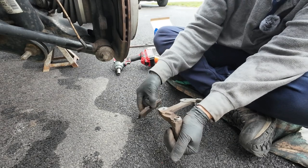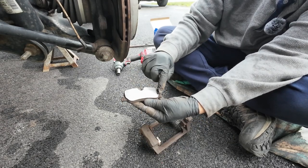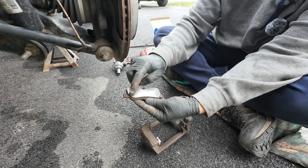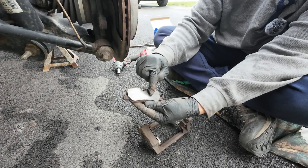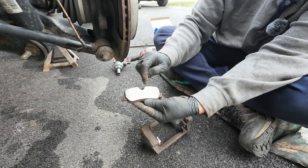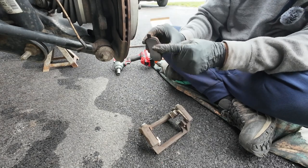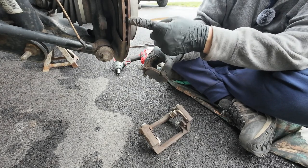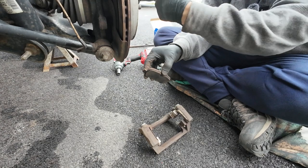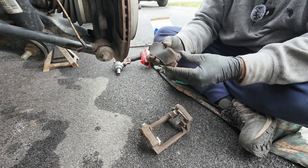You need to put grease on these. This hasn't been used — look at all this on the outside. It looks like a little bit has been used on the front, but the outside hasn't been used. Look how rusty that is. That means the brakes are barely touching the rotors, meaning that all my braking power is coming from the front.